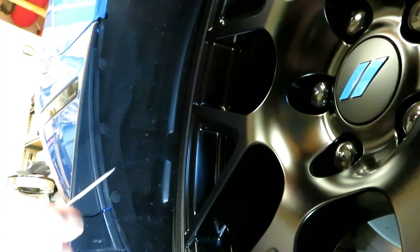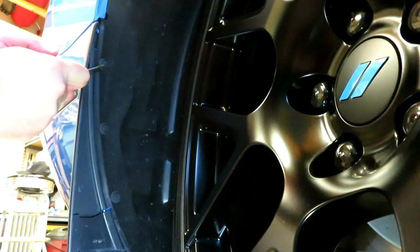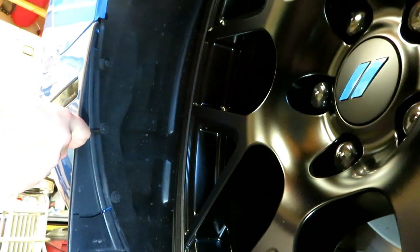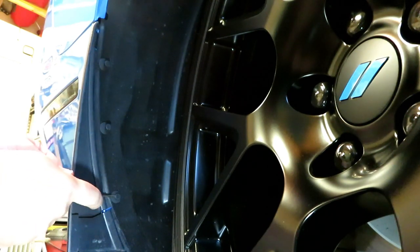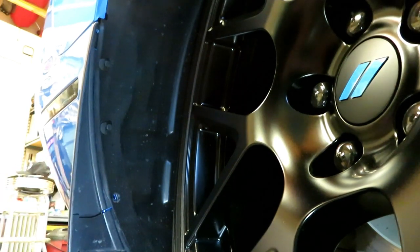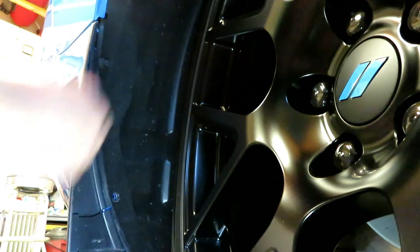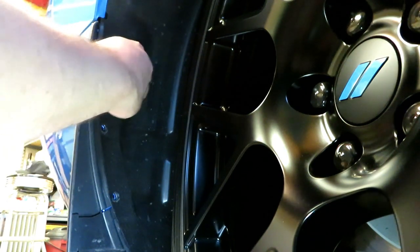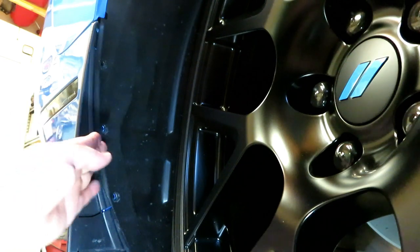Since I have the push-pin rivets, all I need is a flat-tip screwdriver just to pop the center section out. These push-pin ones are a lot nicer than the factory plastic rivet. That whole rivet just popped out — that's what the replacement looks like. You'll want to take all three of them out. If they're your original ones, you have to break them to get them out, but then you can replace them with quarter-inch push-pin rivets.